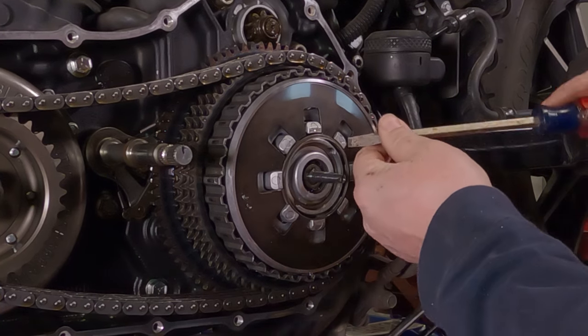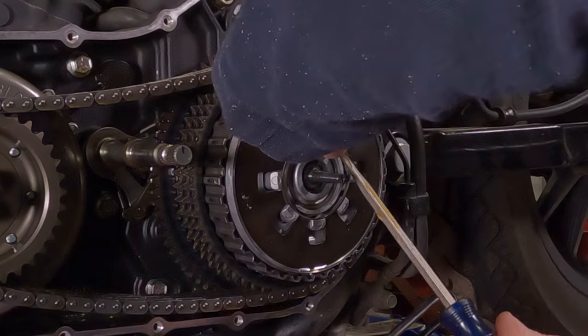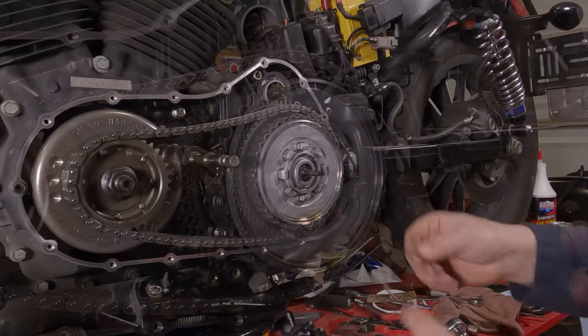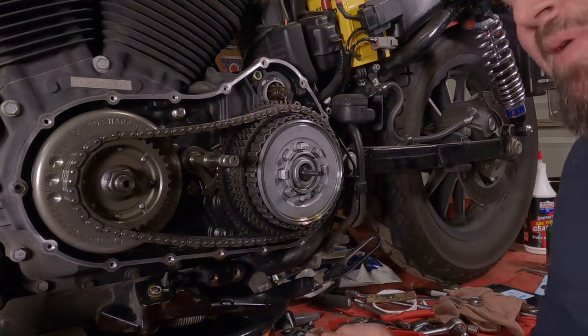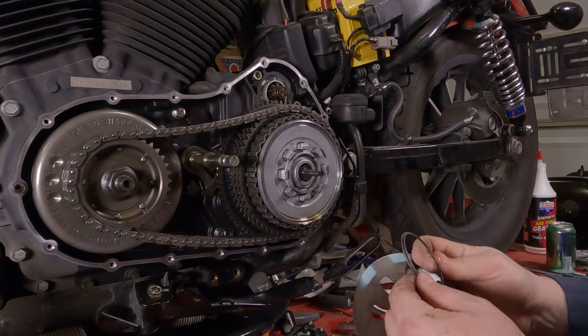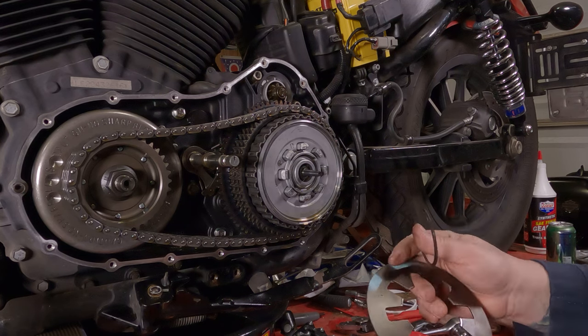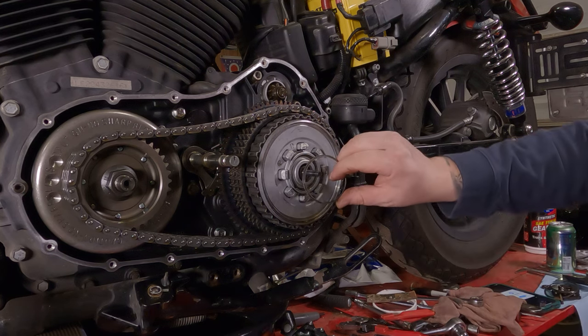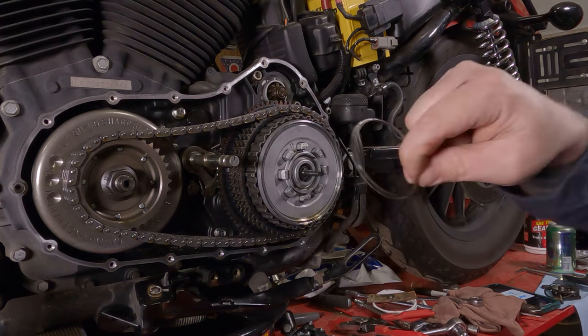Ooh, the pressure plate kind of locked onto it. We're going to be very careful with this. So this ring here was still caught in the groove a little bit, and it was still loaded up by the pressure plate spring. So, don't do that. Now I'm going to have to take a little file and deburr this, but otherwise it looks okay. So be very cautious when removing and reinstalling this, whatever this ring is called.